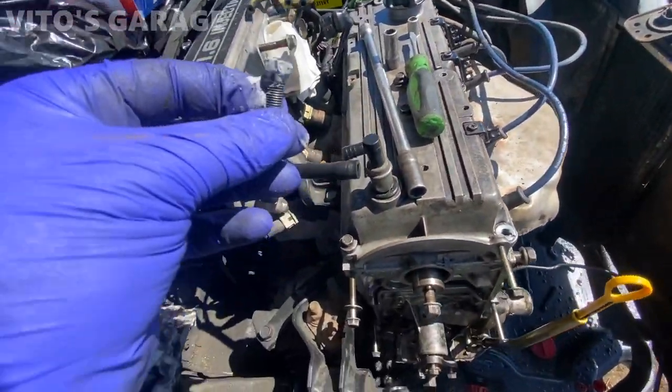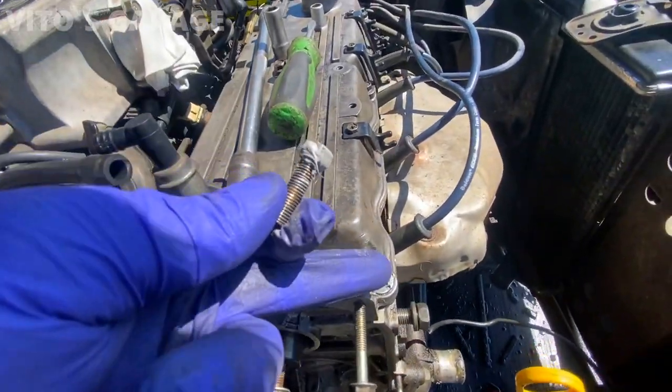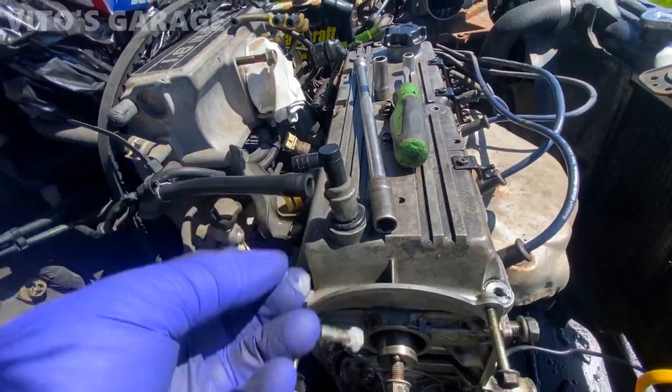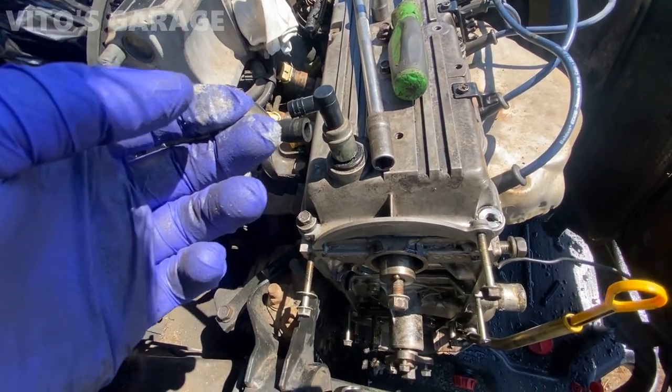All right, so the valve cover is basically installed. It's just this bolt. I'm gonna add a little bit of sealant because it goes right here. Unfortunately, I can't use the factory rubber grommet on it because this bolt is just too big because it was repaired. And nice, it would just happen on camera.